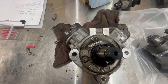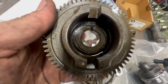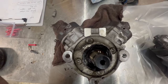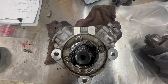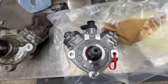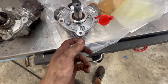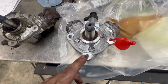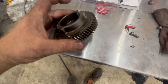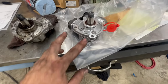This is why we timed our pump when we lined up the marks on our gears — there's a slot in there for the pin on the shaft. Look at the orientation of the pin on the old one where we timed it, then look at the orientation on the new one — they should be exactly the same. Now we're going to stick our pump in. This is a helical gear, so take note of that — when you slide it on, they're not just straight-cut gears. We'll torque the pump and torque our nut.